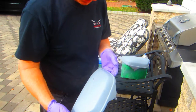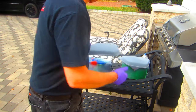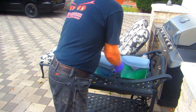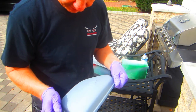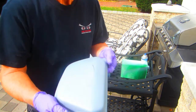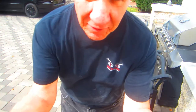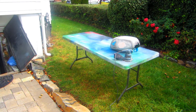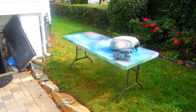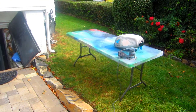Looking at how this has dried up, it's pretty much ready — I think we're ready for some paint here. This one has one more little spot I've got to address, then these are pretty much going to be ready. Maybe I'll sand them one more time since it's for Ray and Marilyn. Machine sanding bondo — I've got about 90 percent of it done. Time to put the second skim coat on, and while that's drying I can work on the side covers.